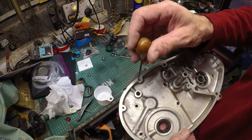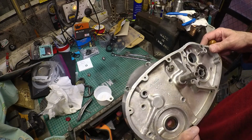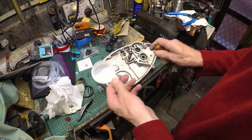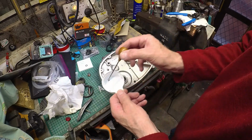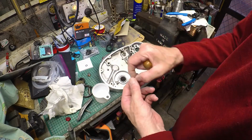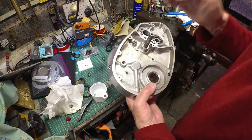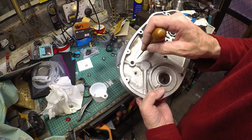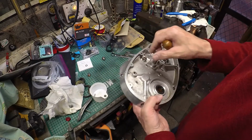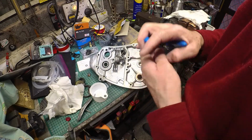Anyway, that seat down there needs to be perfect. And as I'm looking down there, it doesn't quite look it. Again, I'll find a way of looking down at that better, because the ball bearing, I actually ordered a new one. The ball bearing needs to, there we go, magnetic, needs to be a perfect fit onto that aluminium seat. So I'll knock that in with a drift to compress it against the aluminium and just make sure that seat is a perfect 1/4 inch spherical seat. And I say with the right length spring, hopefully it'll be pressed against it firmly enough to keep it sealed. So might as well replace these seals while I'm here, seeing as I've got new ones anyway.